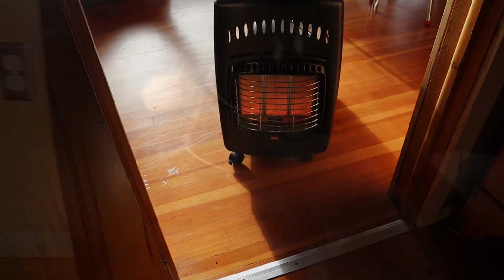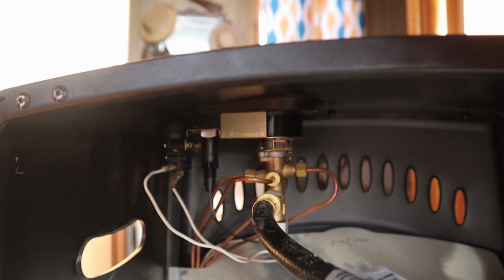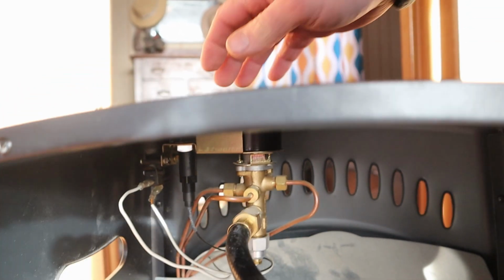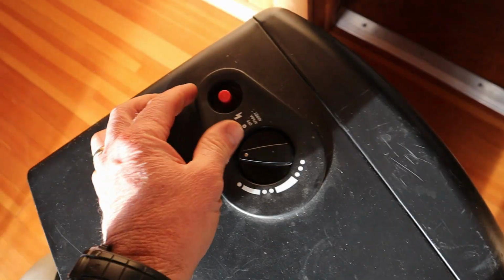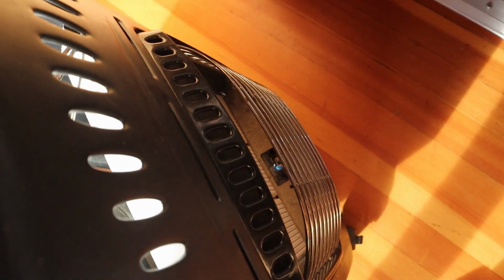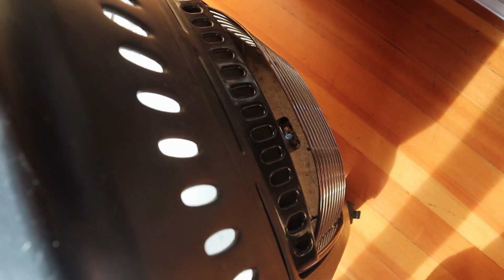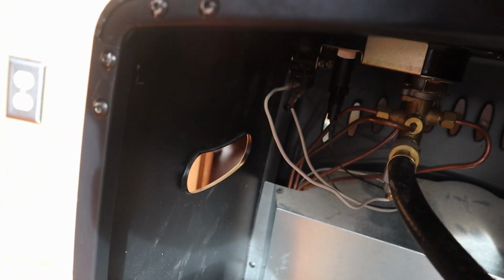Now that we know we've got this thing running, I'm going to try disconnecting my bypass and plugging that switch back in. I bet it's still going to work. Alright, I plugged the bypass switch back in. Now let's turn it back on. Pilot light's on, and then I'm going to let go. And then it went out. Huh, interesting. Let's figure out why that isn't making contact.